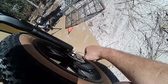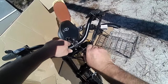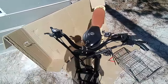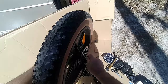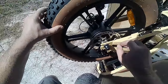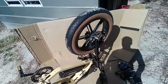I'm going to put the handlebars on so we can flip it upside down and do some adjustments on the brakes. Center those neutral marks — tighten these up, make sure you go around several times. They do look pretty straight. Make sure this neck is tight — it is. Not a bad idea to check everything for tightness. Now I'll flip this upside down — it's easier to adjust the disc brakes. It's dragging a little, but as soon as I use them it will wear right in.